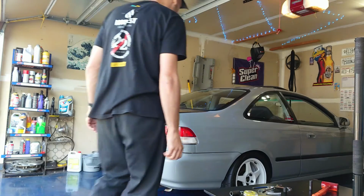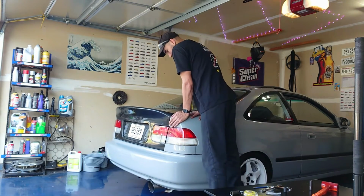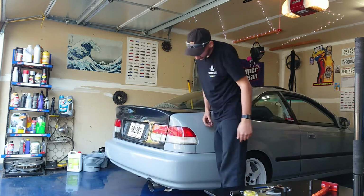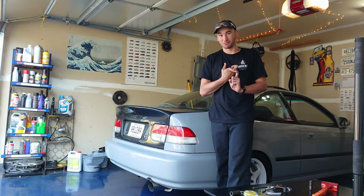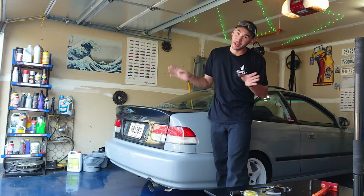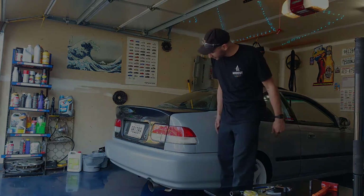All right, now I'll perform a sound test. Listen closely for any squeaks and or rattles. Sounds nice and quiet to me. Now, if we didn't properly lube our bushings, you'd definitely get some squeaking sounds from those things. And then if something came loose when we put the load back on the ground, we'd definitely hear knocking noises from the hardware, but everything sounds good.